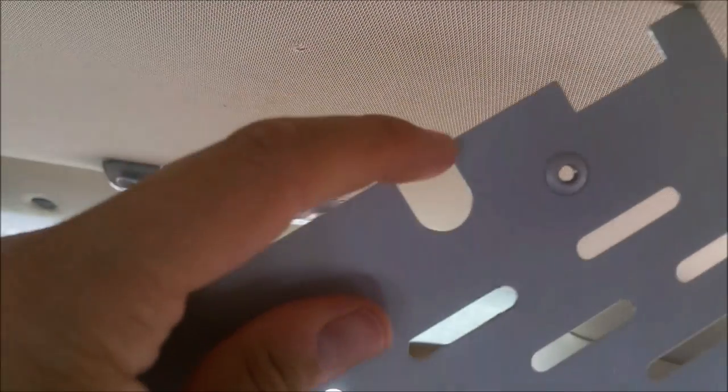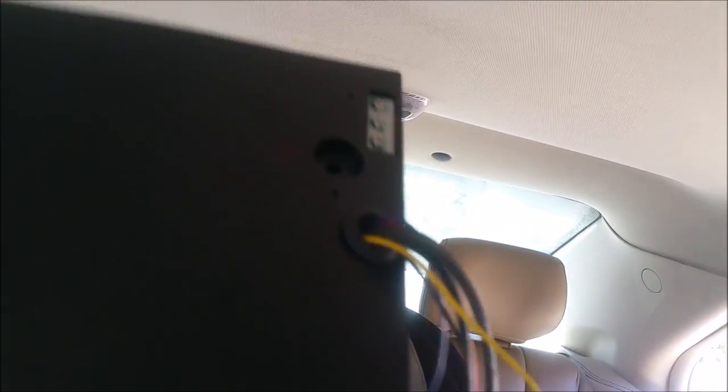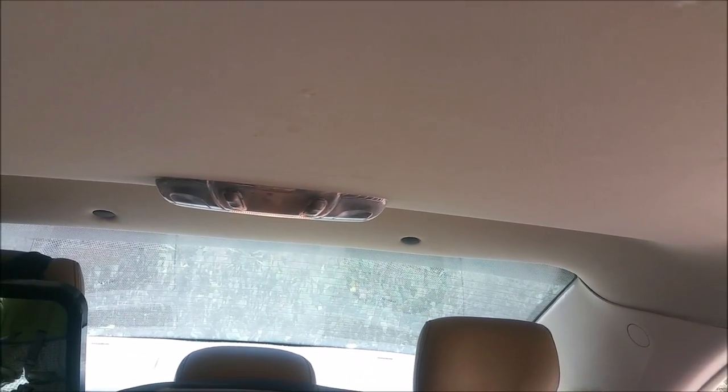The other thing I want to point out is that this bracket is directional — see this little piece there? It needs to be lined up on this side because that piece is designed for those wires, so the little grommet slides in. Just make sure it's lined up correctly before you drill your holes or you might end up having to re-drill.